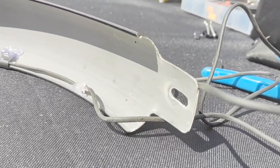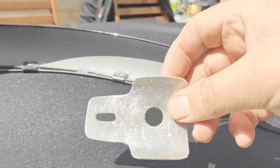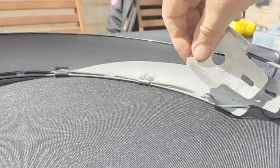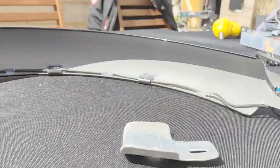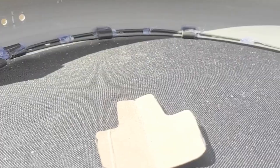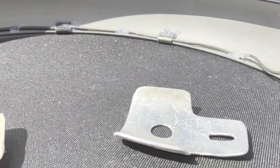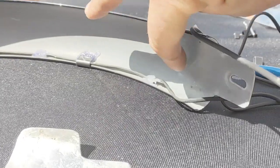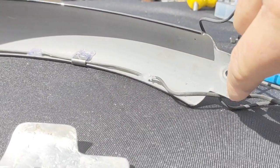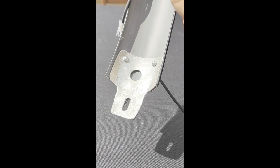But at this end here, there's a lot of talk about how weak it is. So what I did was I made a little insert that's going to go in there and attach it. First of all, I made a pattern out of cardboard, then I cut it out of aluminium, then I beat it to the correct shape. Then I'm going to rivet two rivets there and then that bolt will hold it as well. And there we go, with it riveted in.